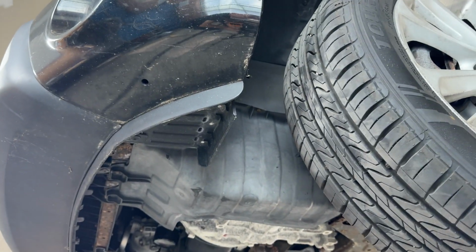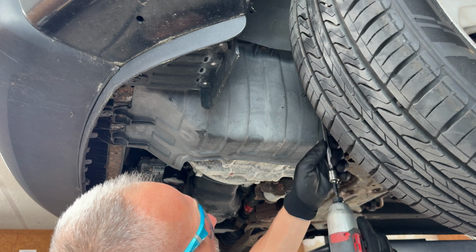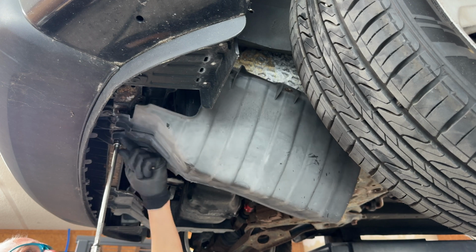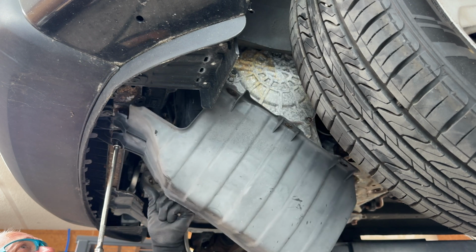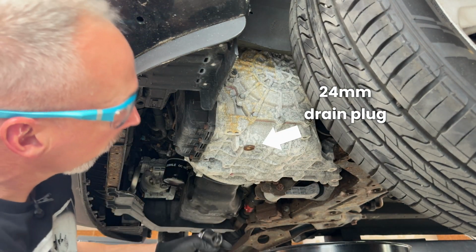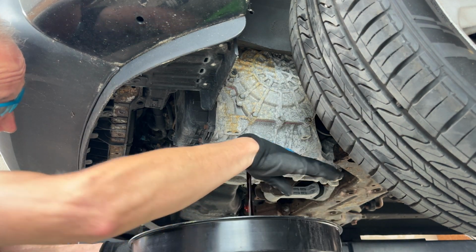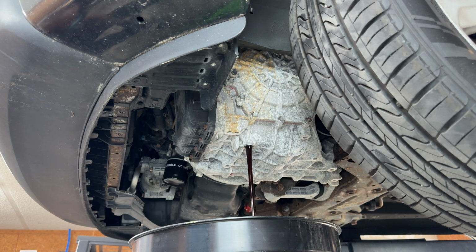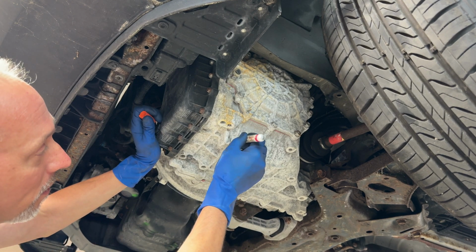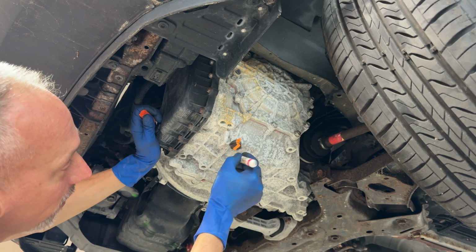We've got the driver's side little plastic splash cover right here. They all look to be about 10mm, so let me grab those. Just all around the perimeter here. Ooh-wee. This thing is rusty and sandy. A lot of beach action going on. I should probably switch to rubber gloves. All right, let that sort of fill my pan. Instead of taking chances, let me go ahead and mark this cover with the old torque mark. That way we know this thing is not gonna leak.